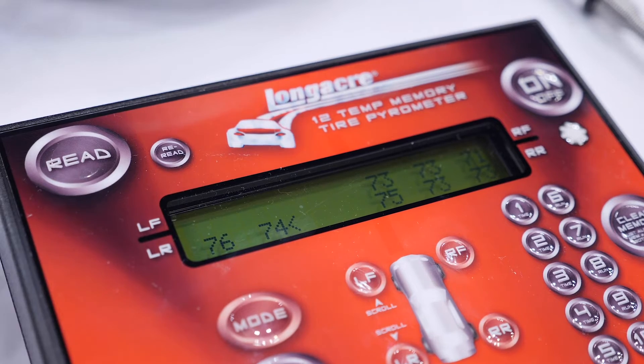Now doing this manually and writing down the results is one option, but of course the tyre temperature is going to stabilise quickly once the car comes off the track, and we've got a relatively narrow window in order to collect all of that data. A better way of doing this is by using a memory recall type product where we can measure the temperature, press a button and record that temperature before moving on and taking our next reading.